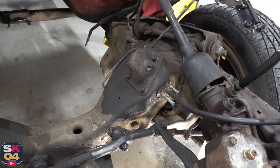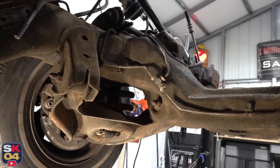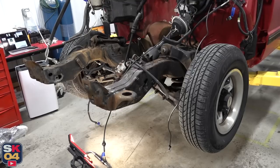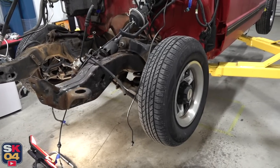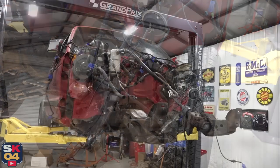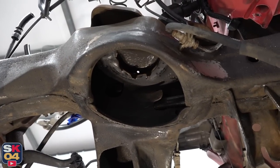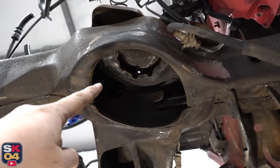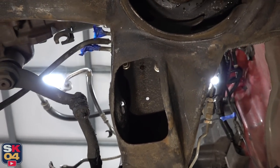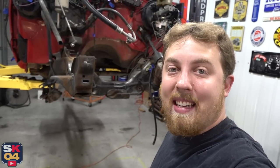You have got to be kidding me. No way to get in from the bottom? No way to get in from the top? No way from the back? And no way in the front? I mean, if you were just changing the plates, you can get away with just removing the coil spring and the lower control arm, but I need to remove the whole suspension anyway for the rebuild. This is what I was talking about — the top bolt for those motor mount plates is in a little recess within the spring pocket. Stick a socket up in there to hold it in place; the other two are accessed from the lower control arm hole. At the end of the day, there is more than one way to go about doing this, and taking out the suspension is the most straightforward because of how easy it is to access those nuts once the springs and the control arms are out of the way.